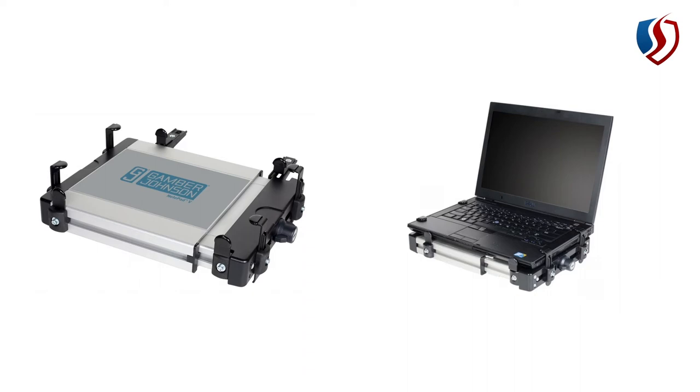We use metal docking stations and cradles — this is an all-metal cradle with metal side clips. This is really important because it's almost impossible these days to mount computers outside of an airbag zone in a vehicle. Vehicles used to have one or two airbags, but now some have 20, and in a full-size pickup truck it's really impossible to mount any device outside an airbag zone. Please make sure you get a metal cradle — don't get spring-loaded plastic consumer-grade ones, because you really don't want your computer to become a projectile in a crash.